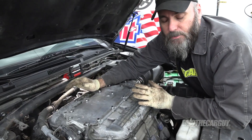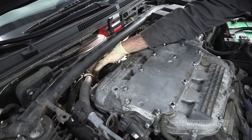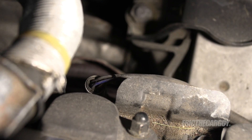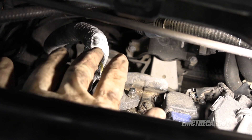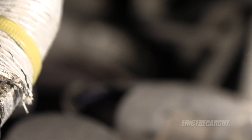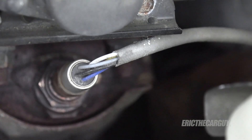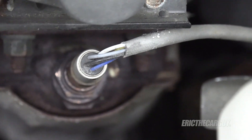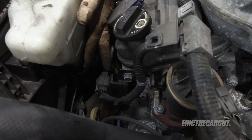The primary O2 sensors are located in the tops of the catalytic converters on this engine — one in the front and one in the back. Located on the back of the engine is the rear O2 sensor. You kind of have to dig down for it. This is the power steering hose here, so almost directly down underneath it is where you want to go. You can just barely see the top of the wires right there. The front oxygen sensor is easy to find — it's right there coming out of the top of the catalytic converter. The same is true for the rear, it's just harder to see. The connector for the O2 sensor is located here; just follow the wire from the sensor over and that's where it is.